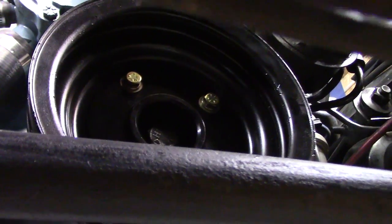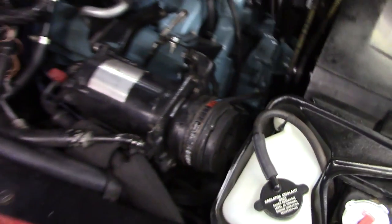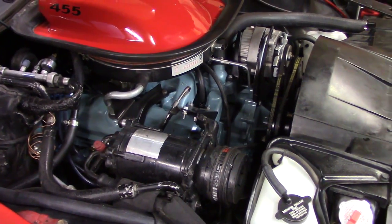Here's a look at some stock pulleys installed back on it - I actually like this look better. The torque spec was ridiculous; I had to take the inspection cover off so I could hold the flex plate to get it. All the belts are back on it now, and our AC belt is actually at the end of the travel now, so it did make a little difference changing out that pulley. We'll start it up and see if that irritating belt squeal is gone.